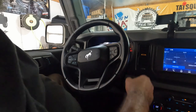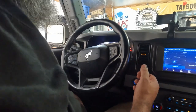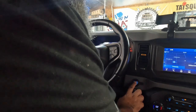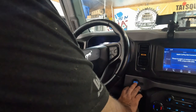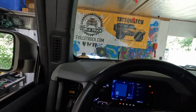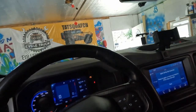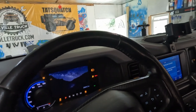Now we're still in brake maintenance mode and we want to come out of it. With the ignition on, press and hold down the accelerator, then pull on the parking brake, then press and hold down the brake pedal for two seconds, then turn the power off and power back on. You can hear a whole bunch of sounds — the brakes are cycling out there. Before I had no brake pedal; now I have a brake pedal back. Start the car like normal.